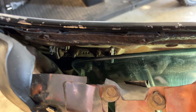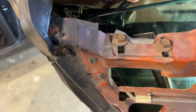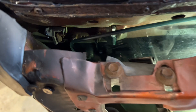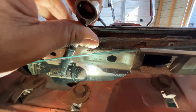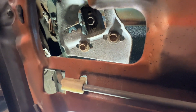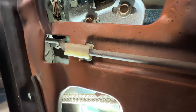You're gonna have those two nuts on there and they are 10 millimeter of course, so make sure you have your 10. But you can't really get leverage on them from up here, so I'm gonna try and come in from the bottom and roll the window up. So what I did was bring my arm through here to get a full ratchet or a combination on them, and then once I got them broken loose I came back up top.